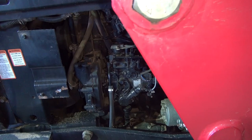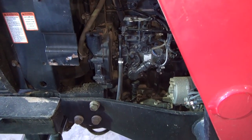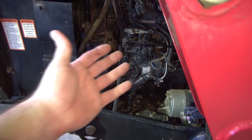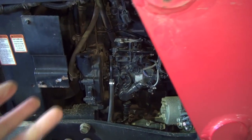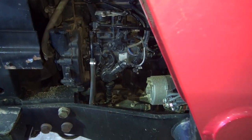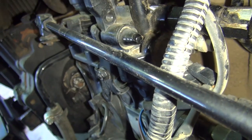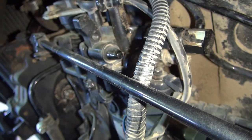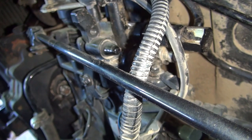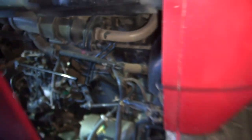This was set from the factory at about 900 RPM — I wanted it just a little bit lower. I didn't film this when I did it because, as you can see, it's hard to see in there and hard to explain and get a close-up shot of what I'm talking about. But I figured this might be helpful to somebody interested in doing this. You can see that little cap on the one I hadn't messed with — you just have to get that cap off without breaking anything on the injection pump, and then you can adjust the idle where you would like.